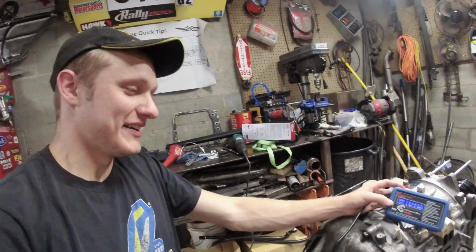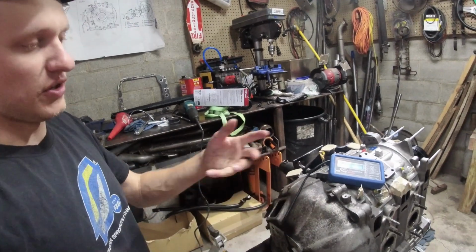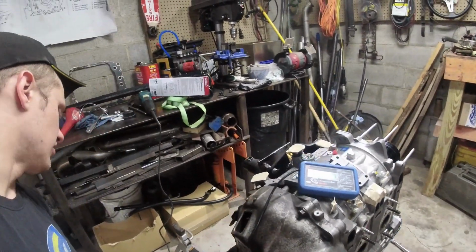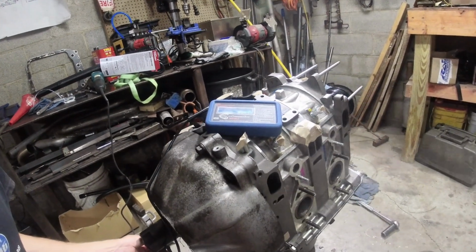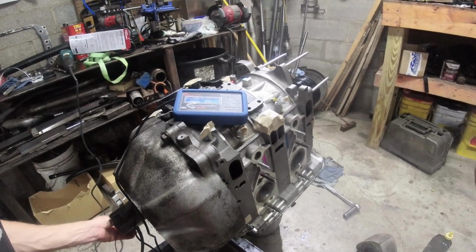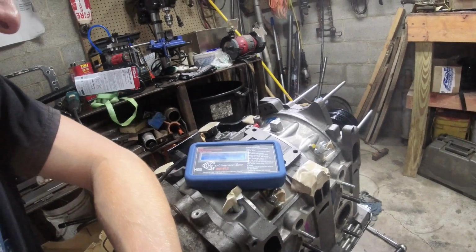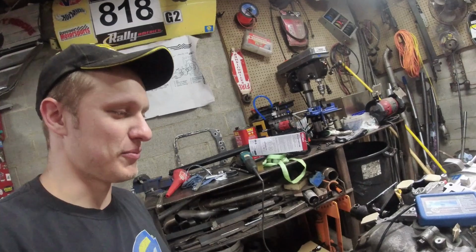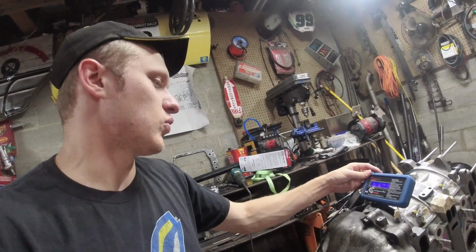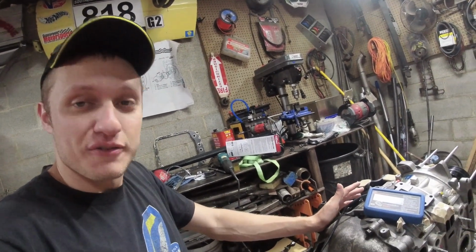So in fact, flooding your engine does reduce the compression. Let's go ahead and crank it over another time, see if those numbers get any lower. 113, 110, 113. Same thing. I'm honestly super stoked that the numbers went down as drastically as they did. So we dropped, effectively I have one number in here that's 110. So we'll just say, using a whole number, dropping 20 PSI for flooding your engine.